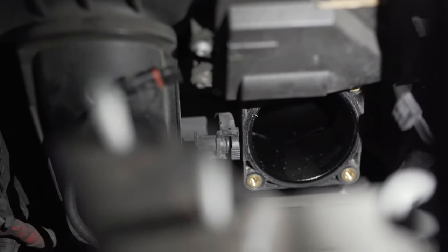Let's take the intake manifold out of here carefully, routing all the wires through. Be careful definitely with the crankcase vent hose right there. Also one more tip — you put it somewhere it might be leaking oil, so be aware of that. And now here it is — that's the starter right there.